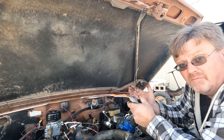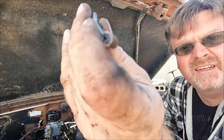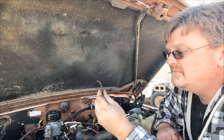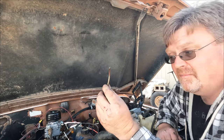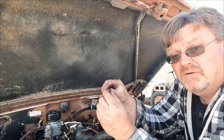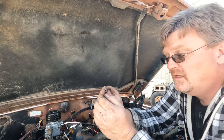When I cut it, I heard vacuum suck — I think the rest of the line is clear. So I'm going to stretch out that curly-Q loop, put the fitting on, re-flare it, and I might have brakes. Maybe. I'm not making any promises at this point.